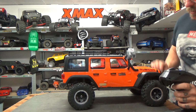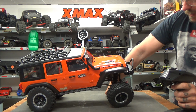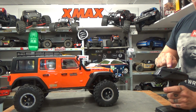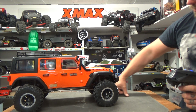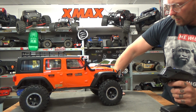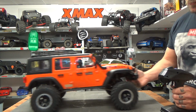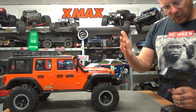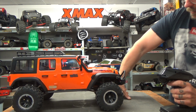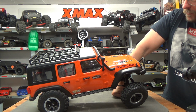So you see it's locked really fast, it really works nice. We're still slipping here because I have not locked the rear, so I put only the rear. I unlocked the front, and you will see the reaction is different. The car pushes differently from the rear, on a different line, and clearly if you lock both differentials, you're going to climb without any problem.